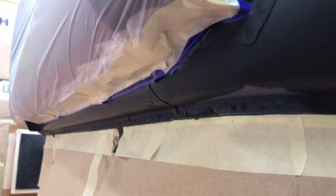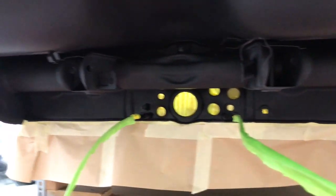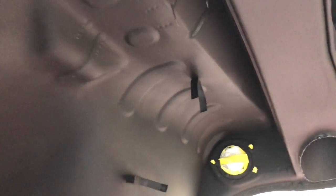I'm going to shoot down the bottom side here. I've got the paintwork masked off as tight as I can get it, which will give us a nice edge. It's going to be a little bit dark up in these fenders, so when I get up inside with the gun and shoot all that black around, it'll be real tough to see. I'm going to run out and get some LED lighting and strap that on my wrist to have some light in those darker areas. Shooting down underneath and right up to the bottom side should be very doable from any angle.